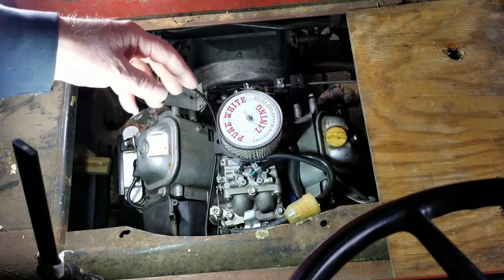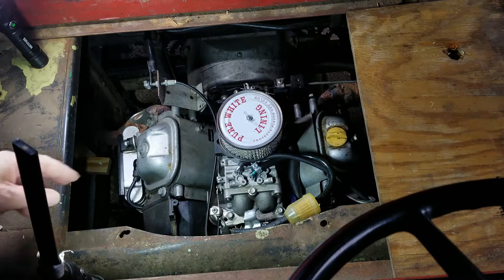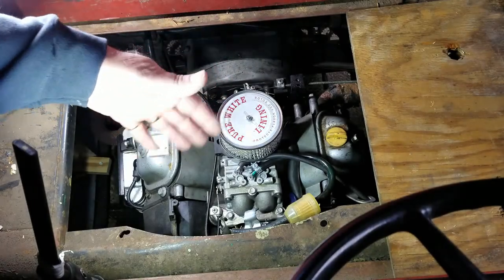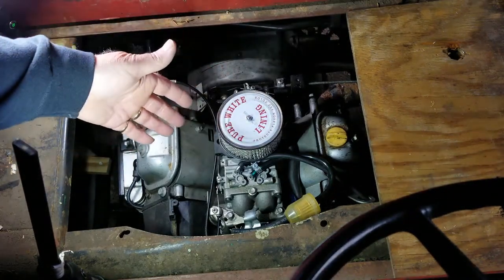105 seems to be the best one from all the people that we've talked with. 105 seems to be the best — just evens out, depending on what elevation you live at. Sea level up to about 1500 feet above sea level, the 105s — when you put the 105s in with equal length exhaust — you even out the idle and you even out all the way up through the rev range. And that's not supposition; we did it.